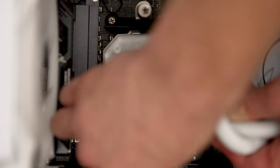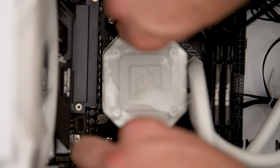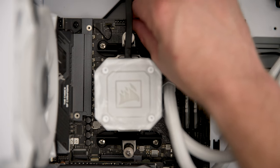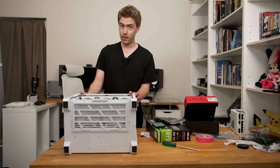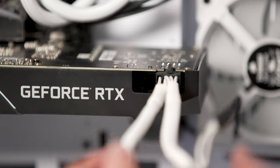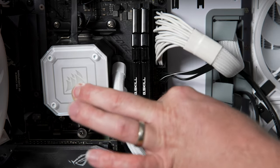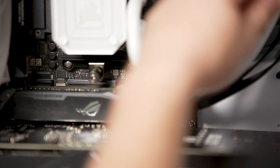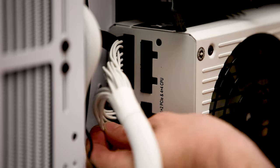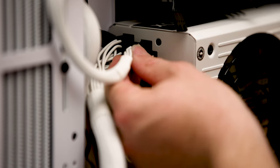Back to the motherboard — hook the little eyelets we screwed in before over the mounts on the CPU and motherboard. Now plug the pump into the all-in-one header on the motherboard and the two fans from the cooler into the CPU fan header and chassis fan header respectively. Now that the cooler is installed it's time to plug everything in. Starting with the GPU — this one's not too power hungry so it only needs one 8-pin cable. Plug in the CPU power at the top of the motherboard, the motherboard power on the side, and all your USB and front panel cables into their designated headers. Also plug in the hard drive SATA cable for when we hook that up. Run the power supply cables through to the back of the case and plug them into the corresponding ports on the power supply — if you have a modular power supply, remember to only use the cables that came with it, otherwise you may have issues with power draw or connectors not fitting correctly.